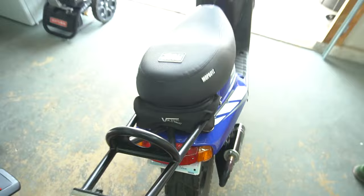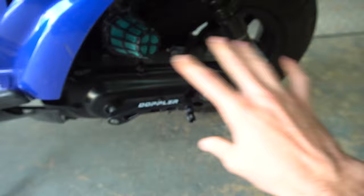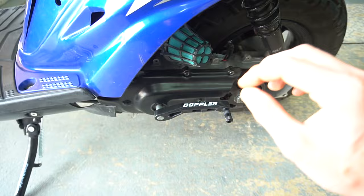One thing we're going to be changing is, when we built this bike, we pretty much kept all the CVT, what came with it. We changed literally everything else on the bike. But the bike came with this clutch, the variator, the belt, everything CVT-wise except for the gear cover was pretty much kept from the previous owner, which is a dialed setup, and that's why I did that. But the only thing I wanted to try and change was running a Stage 6 variator.